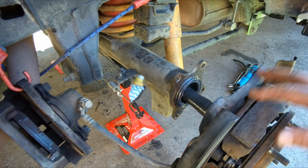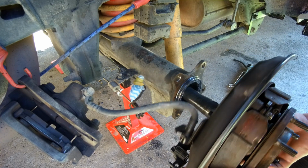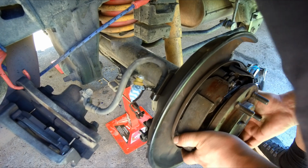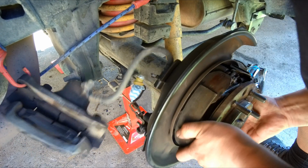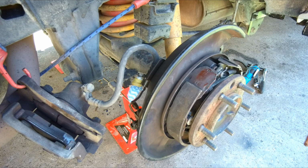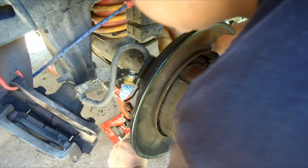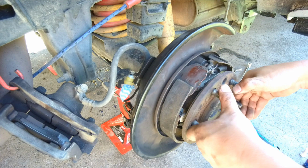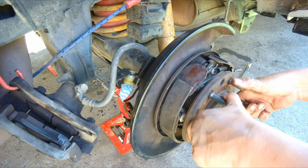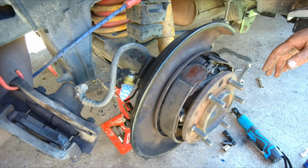Now we can assemble the right axle back to its place so it will engage with the differential. And just like that, put in the 4 nuts. Don't forget, use Loctite. Check that it can turn and engage smoothly. Next we will do the left hand side, same thing.